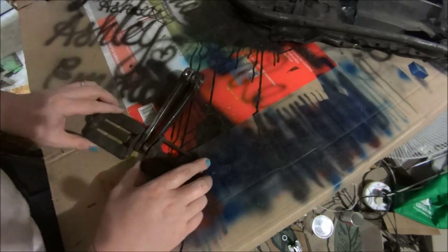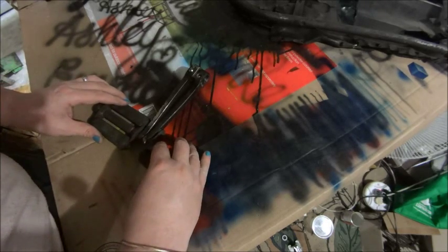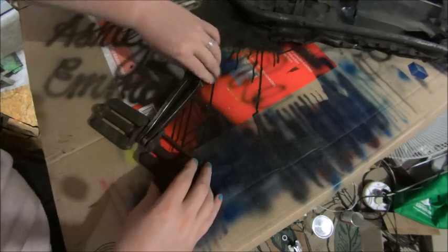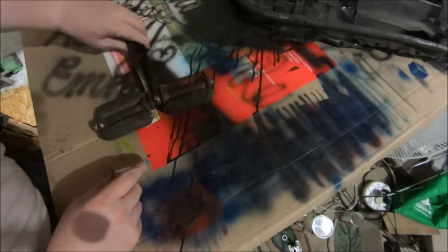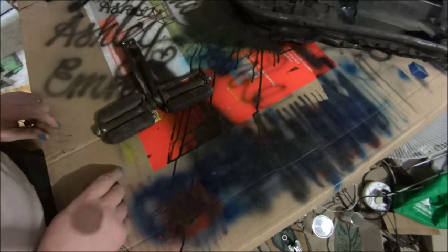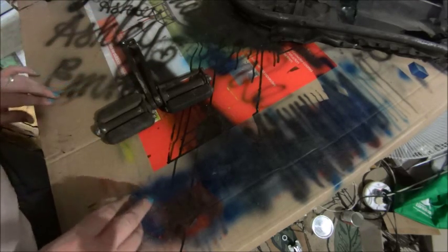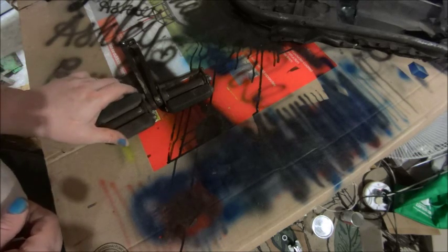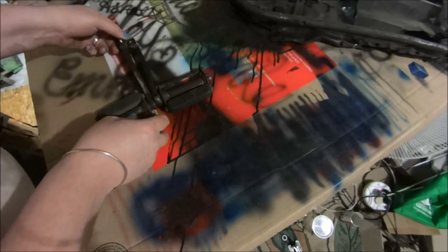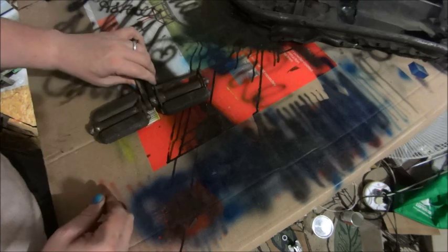These are the two main pedals — the cranks. They've both got fairly considerable bends in them when you take them off. If you sit them so they're nice and neat, they point in different angles and directions like they probably shouldn't — makes the bike a bit difficult to ride. So they're going to need straightening out. I've spent today making up a jig and I'll make a special video about that later. They're just forged steel so they should straighten okay without too many side effects.